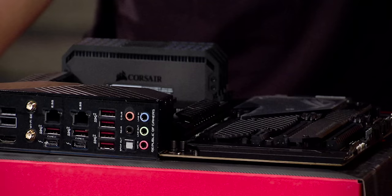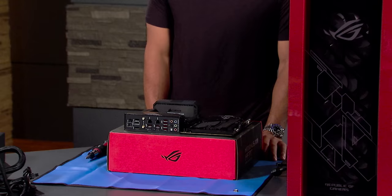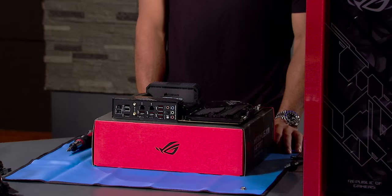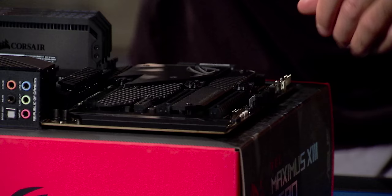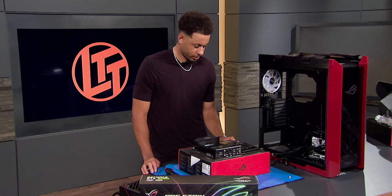We're making really great progress here. You're a great teacher, man. I kind of lied to you before — the CPU is not really the hardest part, it's just the riskiest part. In the very bottom corner of the motherboard, there's nine little pins sticking up labeled F panel. That is the hardest part. I call it F panel because when you're working on it, it makes you say 'ah, I wish I wasn't working on this.' This is another time where big hands are at a disadvantage.